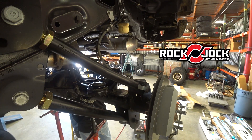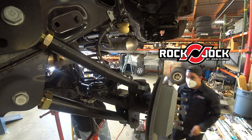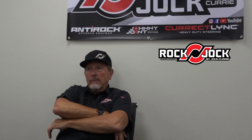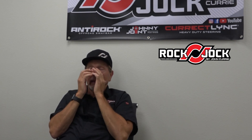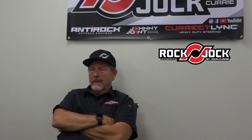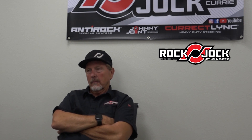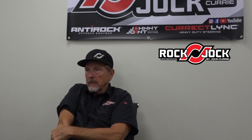Just let us know on these springs — these are actually a hot-rolled spring, not a cold-rolled spring. The ones on our test vehicle have been holding their height really, really good. We did that because the original ones were cold-rolled and they were losing height. But they were kind of losing it together so the Jeep was going down evenly — it wasn't going down on one side. We wanted to try to maintain its height all the time, so we went back and changed the process by which they make the springs. We have a guy in Canada that makes those springs and has been doing it for years.